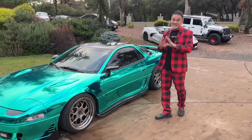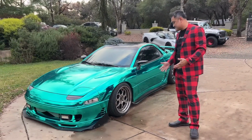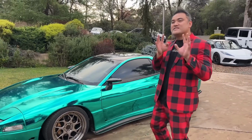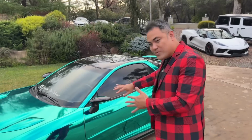This thing was incredibly hard to do, but this chrome was a lot easier to work with than the chromes I've done in the past. With the new heat gun, I'm able to heat it up without discoloring it. The key is to use the Weldy on level 2. If you've got the Weldy on level 2 and you don't pull on it and just lightly brush it, test it, play with it, you'll see. All you have to do is soften it up a little so the wrinkles can conform.